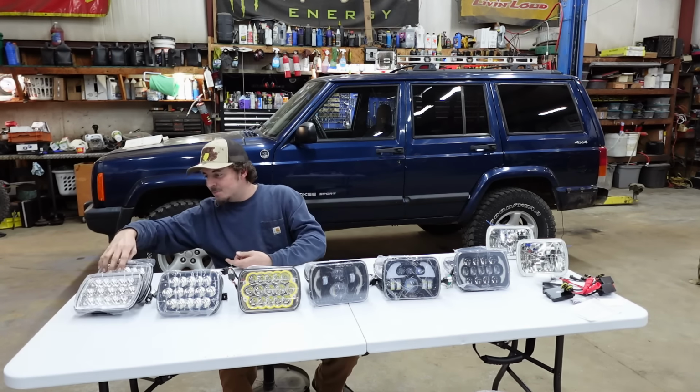I think it's gonna work out perfect. So if you look in their little chart here, I think they want the low beam below the center of the headlamp, center of vehicle to center of headlamp. Yeah, floor to center of. Oh, I did it right. I just didn't read, my bad. So yeah, low beam should be below that, and then high beam should be that.